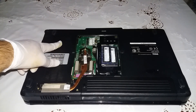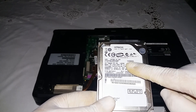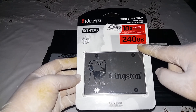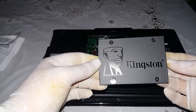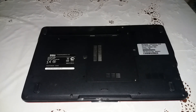Next we replace the regular hard disk with our brand new SSD. We remove the old hard disk — it was made by Hitachi with only 160 gigabytes. Our brand new Kingston SSD is much, much faster and comes with 240 gigabytes. We plug it in just like that. After the hardware installation with the brand new SSD and four gigabytes of RAM, we will install Windows 10 Pro 64-bit edition and see the big difference.